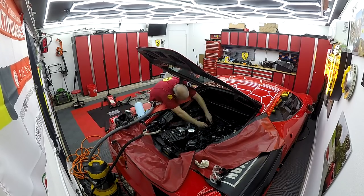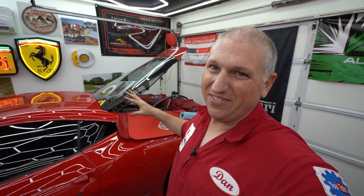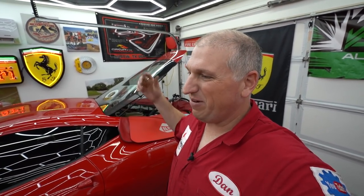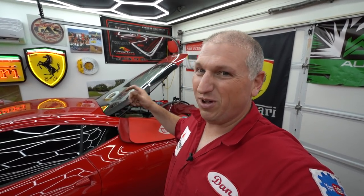We got six cylinders done. Now we have to jack the car up and rotate the crank so that the cams are off the lobes and those valves come shut — we need cylinders one and seven to close. I probably need to rotate the engine about 180 degrees, which should rotate the cams 90 degrees and get them off the cam profile. The way to turn the crank is to use a screwdriver stuck in the starter teeth and gently rotate it one tooth at a time — there's no way to get a wrench on the harmonic balancer bolt.